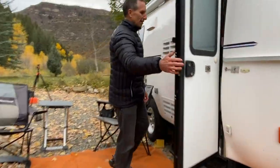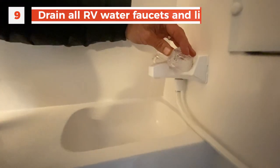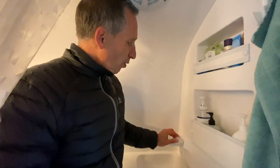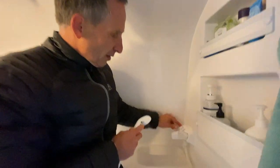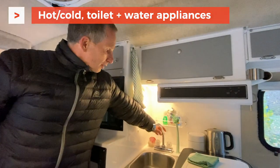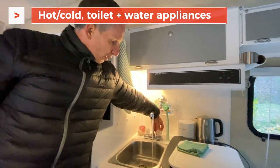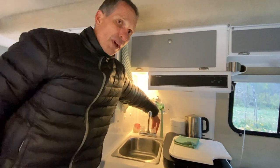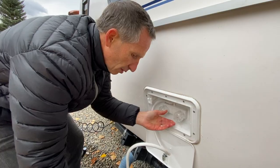Now the compressor is running — I'll go inside and start running the water. Drain the faucets — I've got water coming on now, and it quickly turns to air. I'll do the cold and the hot, and the shower head. Make sure you run every single faucet: shower head, any external showers, any sinks, toilet. Some of these have dishwashers or laundry machines. Make sure you get the water blown out of every line. Make sure you do both hot and cold. Keep the air through it, then get the antifreeze into all those lines.